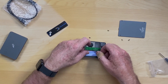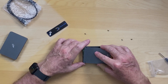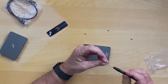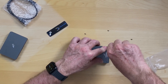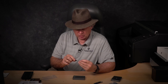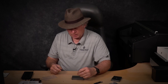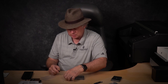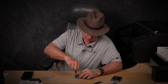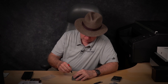So basically we're just going to lay the thermal tape on top and push it down firmly to make sure it's stuck. Then we put our top back on. They do make a couple of chips that are different thicknesses and some cases won't handle those - I actually tried one and it wouldn't fit, but I think this one will handle those as well. We throw our four screws back in. Easy to build - like I said I think it saved me about a hundred dollars and I actually like the little case. I'll snug these up pretty tight to make sure it pulls up tight to that heatsink.